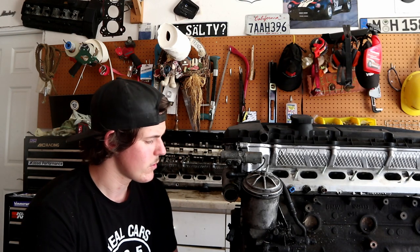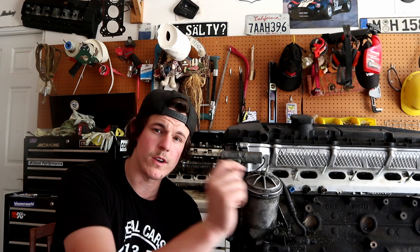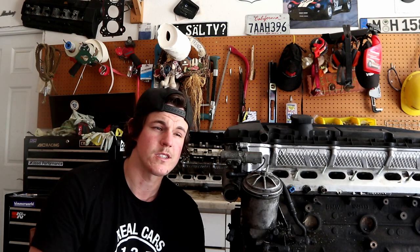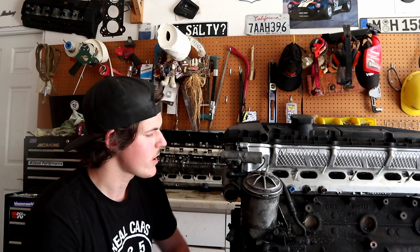And the thing is that motor has 215,000 miles on it. So the head gasket is also seeping a tiny bit of coolant. I've never had to top it off since I rebuilt the cooling system maybe a year and a half ago. But I can see coolant residue on the outside of the block where the head meets. So I do know it's seeping to some degree. It's not bad at all, so I'm not super worried about it.